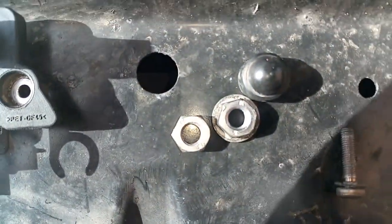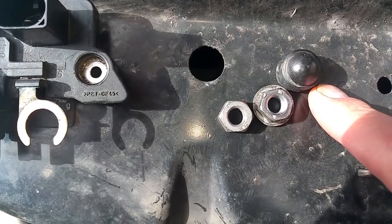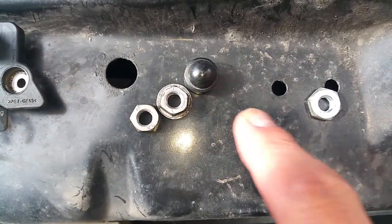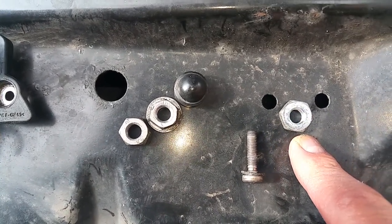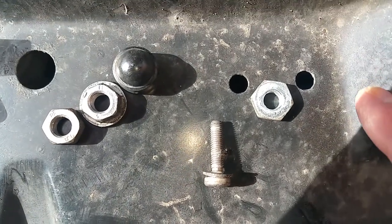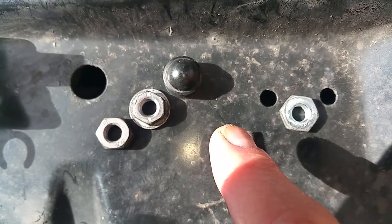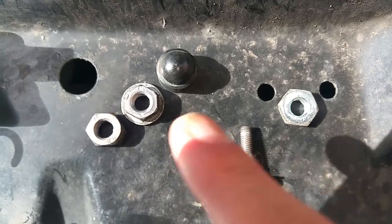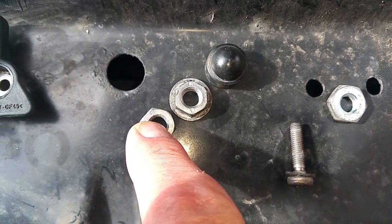What you need to do is take off the little rubber cover over the main output post to stop it shorting out, and take this nut off, which is 13 mil. Far right there's a bigger nut — it's 15 mil — and then a Phillips screw at the bottom. Once you've taken those three out — one, two, three — you can take the cover off. I couldn't actually get the cover off because of things in the way, but I don't need to remove it; I can just push it to one side. When you take that one off, there is another nut underneath.